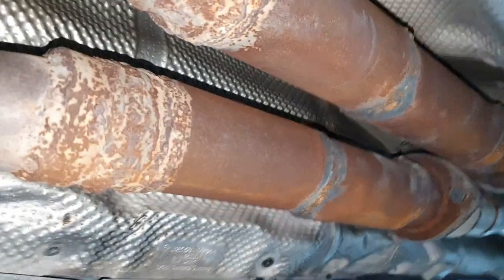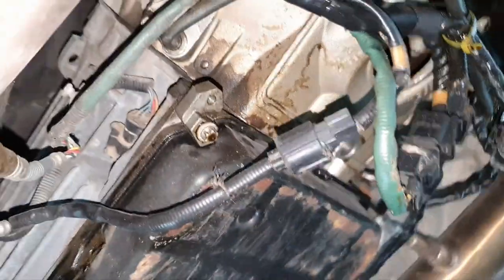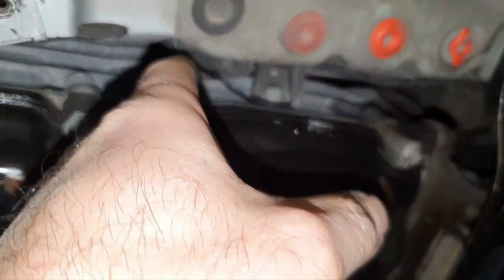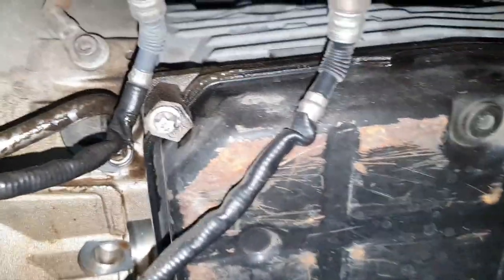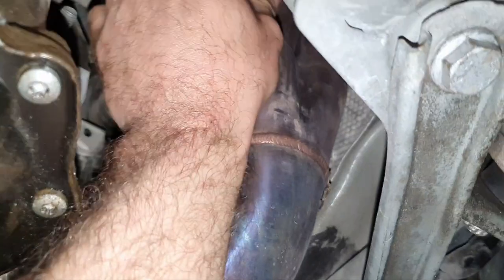Continue with the modifications here. Oh boy. Also the front drive shaft rubber coupler needs to be replaced. Yep. Transmission mount looks new, full up. We see some oil here. The cover is missing for the plug. Looks like the transmission up top is dry. Here where the seal is, it's wet. You see? It's leaking the seal all around. Take a look at it put on the ground here. The seal for the steering shaft is missing completely.